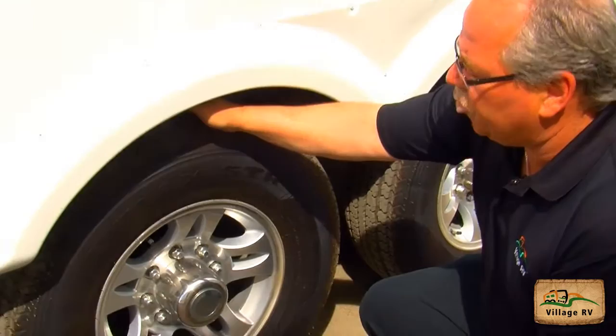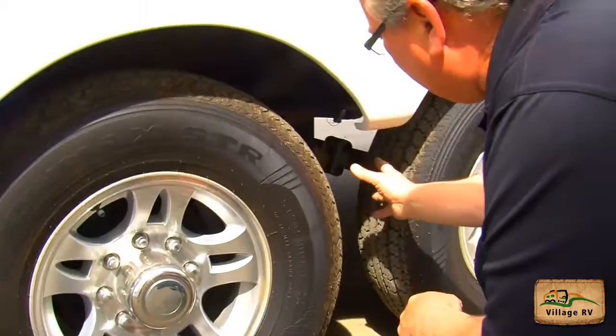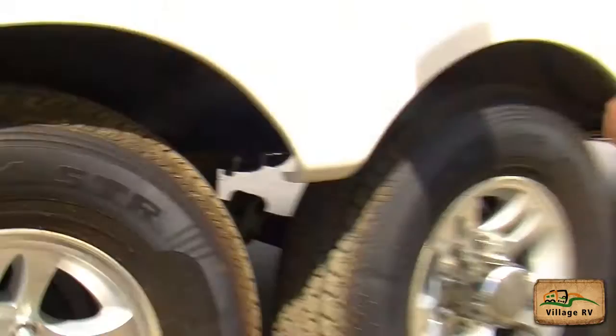My landing jack on this side is secure. All my covers and awning are closed and secure. Fender skirts are secure. On the trailer tires, I've got lots of tread with no cracks in the sidewall or rim. I checked my lug nuts and air pressure — all good. For suspension on this side, there are no loose wires. The springs aren't cracked — everything is secure.